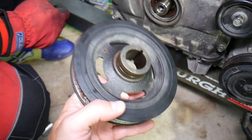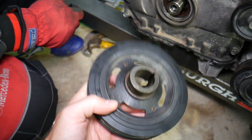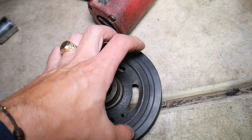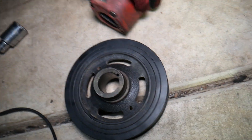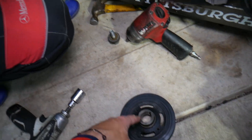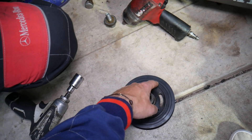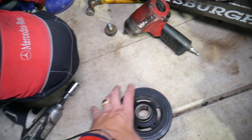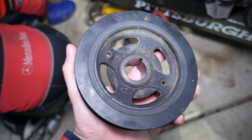That's how you remove the crankshaft pulley. You can see the rubber bushing goes all the way around between the two parts, holding them together so it can absorb vibrations and make your engine run really smooth. But eventually they can fail — especially if you have a leak from the crankshaft seal that drips on the bushing. Over time it can overheat, get soft, and fall apart.